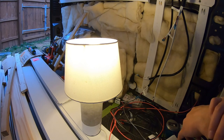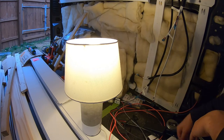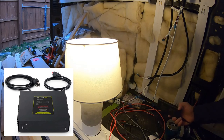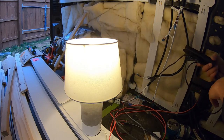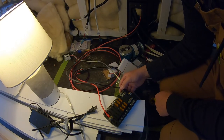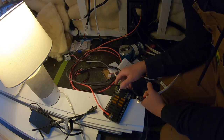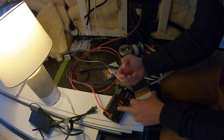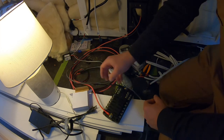That shore power plug will connect to our Goal Zero. Once we upgrade to the Yeti 3000 we have a fast charger that charges at 25 amps - about five times faster than the normal wall charger. So if we're ever at a campground with electricity we can plug in and get decent power. The thing I wanted to work on was setting up all of our electrical items to our Blue Sea system. I'll take the fuses out for now so we don't have to worry about anything being powered on.